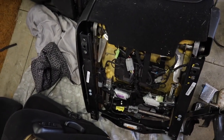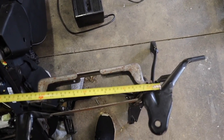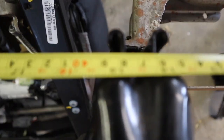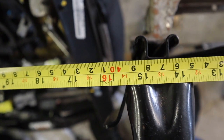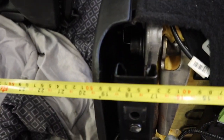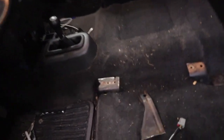I'll put a side-by-side comparison to show what I mean by the sliders being different widths. Let me grab a tape measure and measure this stuff real quick. The stock seat sliders are roughly 15 to 15.5 inches, and the new SRT seats are around 19 inches. So that's why we have to extend it and do what we did - just trying to make it as clean as possible.